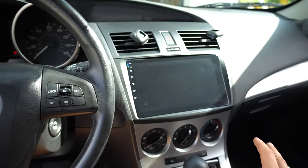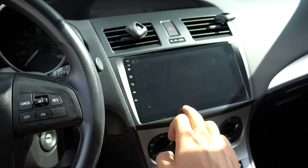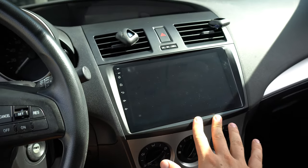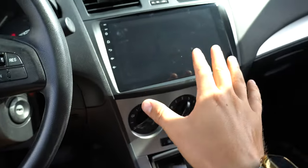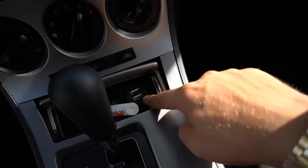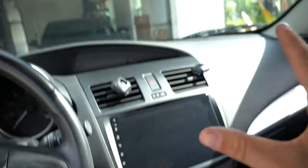I'm going to explain and show you guys the three different ways to hardwire your dash cam and make it look clean. The first way is plugging it in — if you have an aftermarket radio, usually in the back you can plug in the USB behind it. When you turn your car on, the dash cam will immediately turn on, and when you turn your car off, the dash cam will turn off as well. You can also cleanly hardwire it and plug it into your USB cigarette lighter. The third way is using the hardwire adapter kit and putting it in the fuse box.